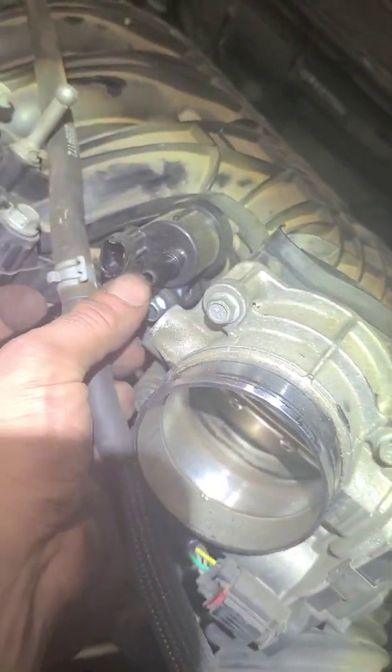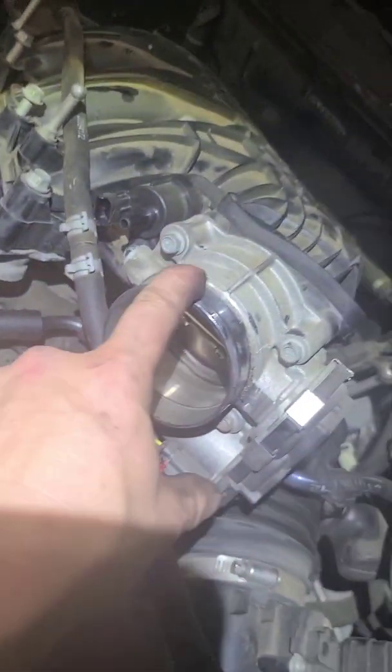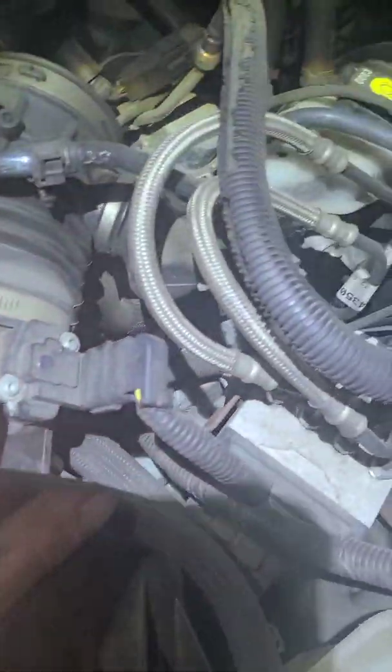On the front, you're gonna disconnect your PCV hose and this electrical connector. There's an 8mm clamp right here holding that in. Let's see. Here's your little, see that? That's for your, I want to say PCV. Just push a little button in. This right here goes on that breather tube right here on the back, and to release it, you're gonna push forward right here.